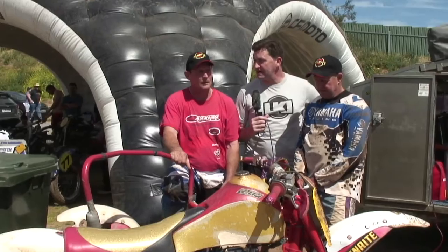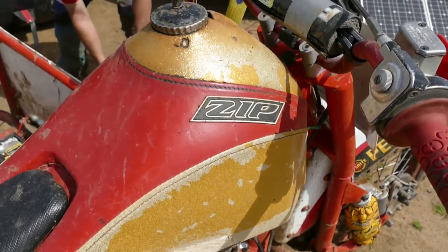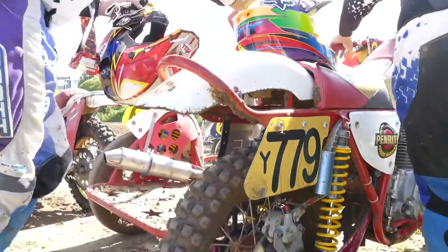We're back at the Pre-85 class. What we're looking at is Gary Glitter — what these guys call Gary Glitter — it's an AML. What size stroke are we running on this thing? It's an 880. It was originally a 750 kit, came from the UK with an 840 kit, and when he blew it up the first time they decided to do a re-phase and put a big bore kit on it.